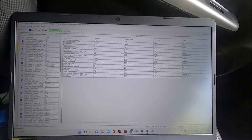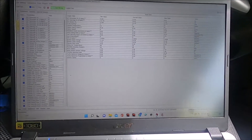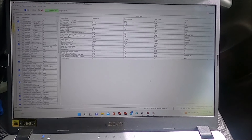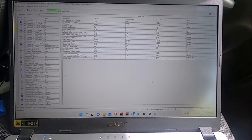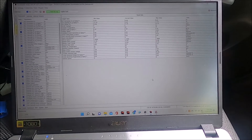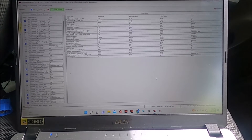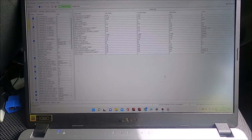For data logging, I use another piece of software called ROM Raider — and all of these software tools are free to use. With ROM Raider you can data log almost every single thing the ECU is seeing or monitoring: air-fuel ratios from the wideband sensors, coolant temperature, engine speed, knock, air flow, throttle position, vehicle speed. Every single piece of information can be captured into a log, which I then upload to MegalogViewer, a separate piece of software, to view the data.